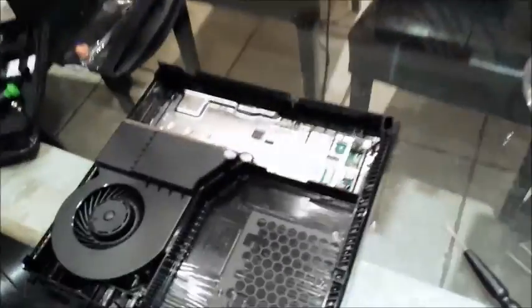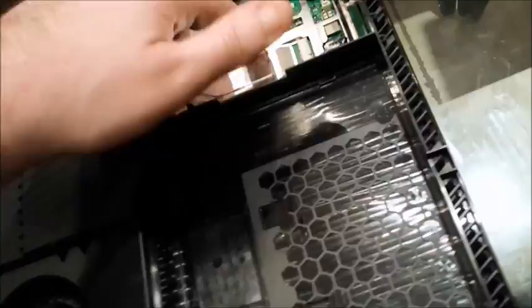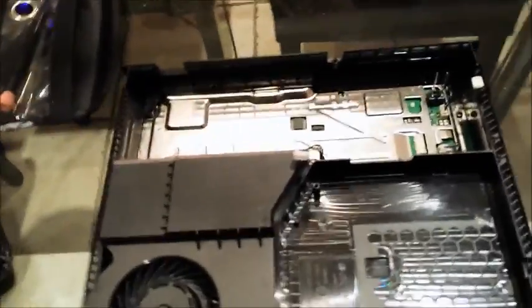All we have to do is take out this black screw right here, flip the whole board around, take off the plastic, and then we can separate this metal shield — which has the same exact thing on the other side — holding the board inside the middle. Open it up, expose the chip, clean it off. I have Arctic Clean, really good stuff. Then I have stuff that purifies and readies the chip. Arctic Silver 5 — put that on once you clean the chip. Reverse the process. This should be done in probably another 20 minutes.